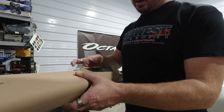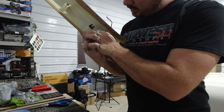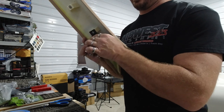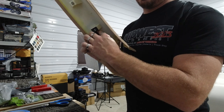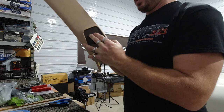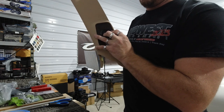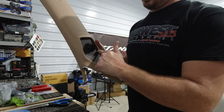So we're gonna put this in here, and the way I made this is I can just basically go around here to the back side, and then you can just get this collet on here and this ring, and then boom, you just tighten everything up. And then you don't have to worry about anything, because the other plastic tweeters, you gotta glue them in or fiberglass them in. These are super nice the way that they work, because you can just turn this collet on the back side and then everything works out for the best. Versus, I hate having to hot glue or glue in tweeters or things like that. That is just a nightmare. So this is one of the reasons why I like the 4000 series tweeters as well. Plus the grill, everything on these is metal and they just look absolutely amazing.